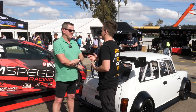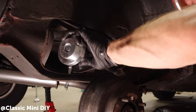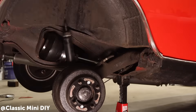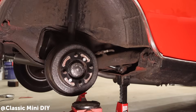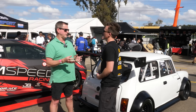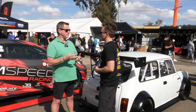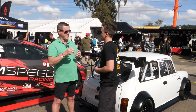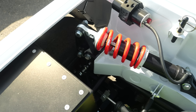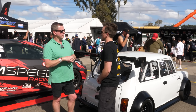Going with the cantilever and bell crank, and using a two-to-one ratio, we can turn 30mm of wheel travel into 60mm at the damper. The original Mini suspension uses what they call a rubber cone system — basically a rubber ball with a cone that compresses as a spring, with a separate shock absorber for damping. This setup is a massive step in the right direction, although at the same time we've maintained a lot of the original pickup points. Minis handle really well out of the box — we don't need to reinvent the wheel, just upgrade it. We're still running an aftermarket alloy upright and KAD six-pot brakes on the front.